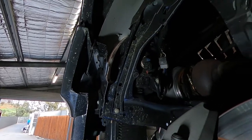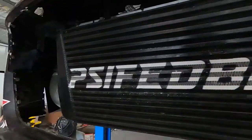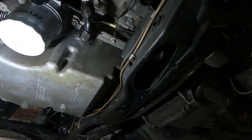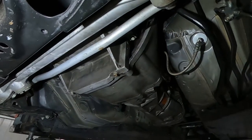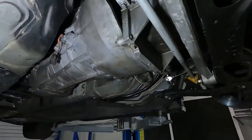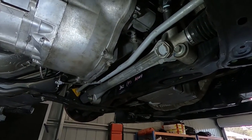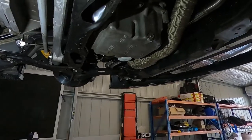We can't clearance that, so across to the other side — this is where most of it was, just on this spot here. You can see it's worn away all the paint right up there. Obviously when we're turning, this looks like it might need a bit more clearancing here; at the front it's okay. So we'll see if we can clearance it a little bit, mostly just lift it up. We've got a bit of an oil leak under here — this has already been cleaned up at the track — which looks to be coming from the oil return and/or the oil pan gasket. My thoughts are that oil has made it through into the clutch and that's what caused the slip. Last time we had an issue it was the rear main; it could be the rear main again. Hopefully not, but we'll pull it out, check it, clean it, and see how much damage is done. If we need to send it back to the boys at MPC to give it a freshen up, because the poor thing's had quite a bit of abuse.